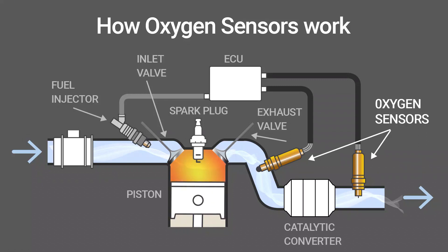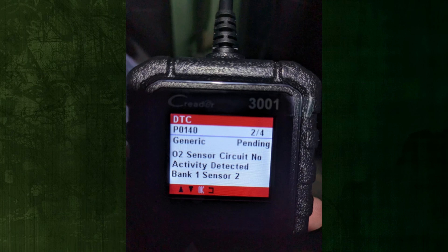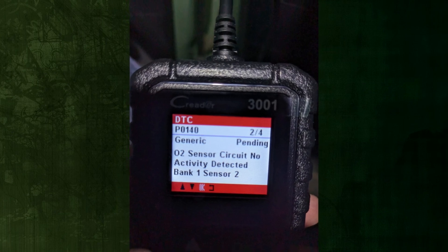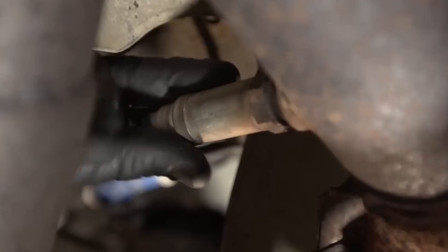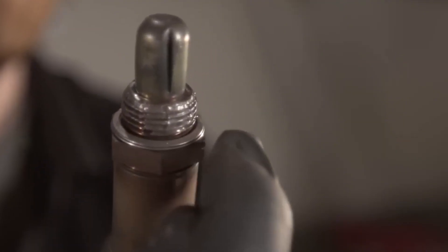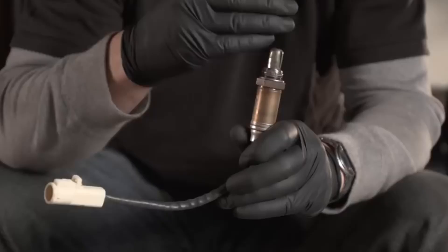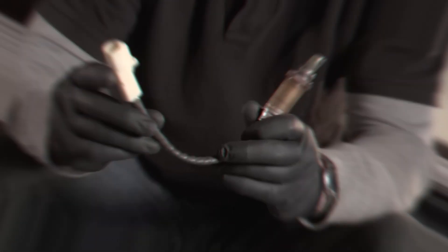The oxygen sensors in your car count the amount of dangerous emissions leaving the exhaust system. There's an O2 sensor before the catalytic converter and one after the converter, and this tells the ECM how effective the catalytic converter currently is. The trouble code P0140 indicates that the oxygen sensor isn't sending any signal to the ECM. It simply shows that the catalytic converter isn't receiving any signal from those parts, which may or may not indicate that your oxygen sensors are broken. This prevents your car from determining whether the system is operating correctly, which is why the check engine light is on.